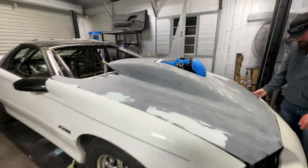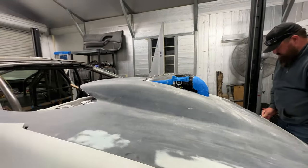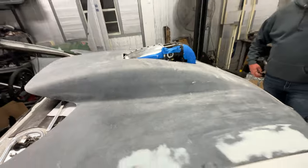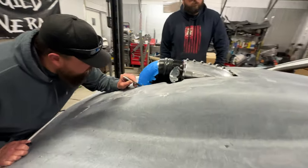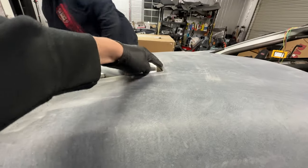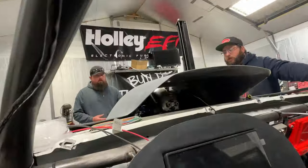Not as ridiculous as we thought — really not a ton sticking out. Kind of what we were thinking. With the hood on it just kind of looks ridiculous, but not actually as insane as I thought. We're sitting deep — it fell past the CID. I need a notch just past the little logo right there, and it looks like the burst panel even stays down inside. We're going to make a few last little things for the throttle cable bracket, make sure we got some clearance around the tube there. I thought I was going to have to cut further back but this is actually higher than I thought — if we want we could always build this back and smooth it in. What's surprising is the burst panel actually sits all the way under it, and I didn't think it was going to. It looks like it might be rubbing right on it, but I think we're actually lower than we'll need to be.